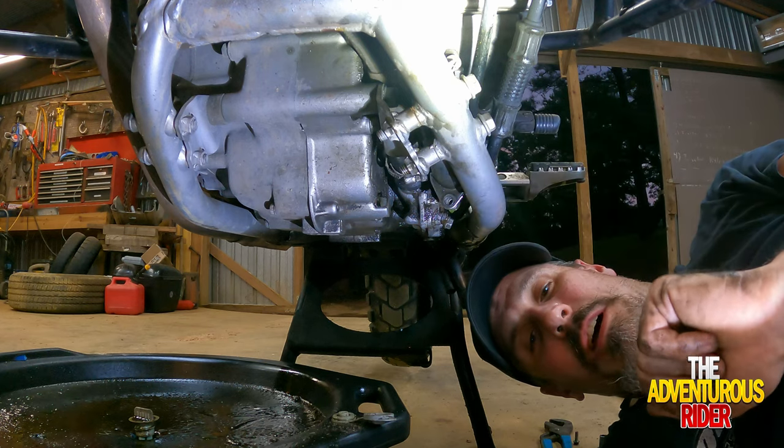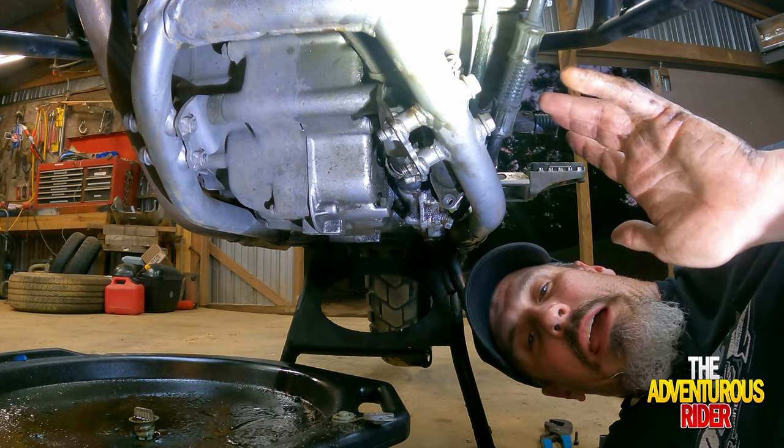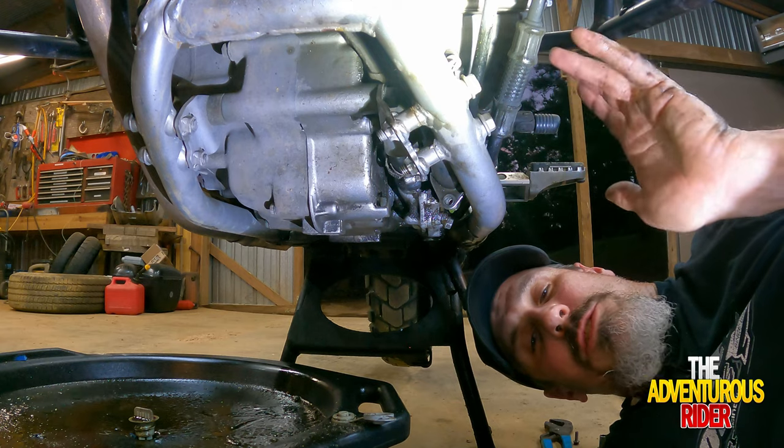After fighting with this hose for a few minutes I'm going to go ahead and remove the oil lines — I'll show you why in just a second. Let me break in real quick: I was actually trying to remove the water pump body and came across an issue the book doesn't really talk about. In order to remove the actual water pump body you need to go ahead and remove the cover over your front sprocket — it'll make the process a lot easier.